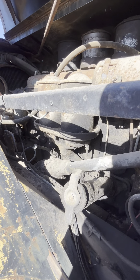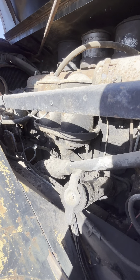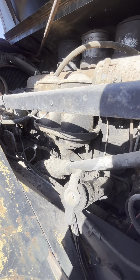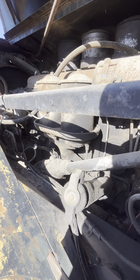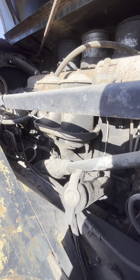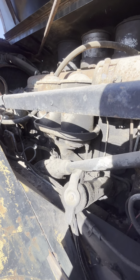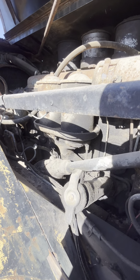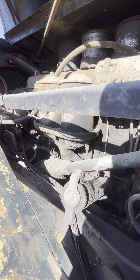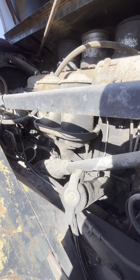This air pressure manifold down here is all original — it's where your air comes in from the compressor and it's routed to the windshield wipers. This trailer brake valve has been added, but it goes down to the original manifold. The cab assembly number — it's a 1500 mile cab, serial number 20337. ADCW 974-098. Horsepower 184 at 2000 RPM. Maximum gross weight 55,000 pounds for the truck only. The gear change plates indicate you have an overdrive fifth, which is nice — at least you've got high gearing on the transmission. Overdrive in the main box is forward toward the dash, and your direct drive fourth is the next one down. There is an overdrive in this up there.